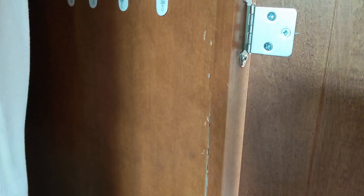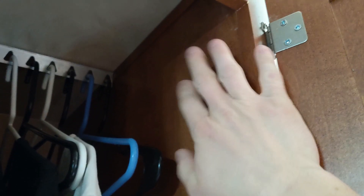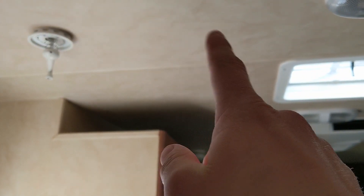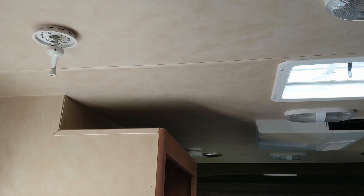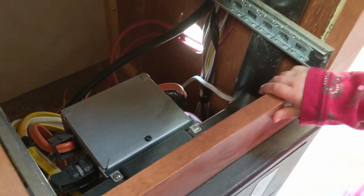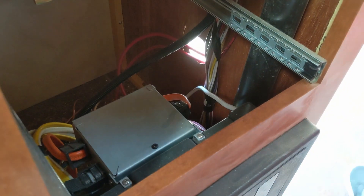To get my cables up through the roof, I've got this little closet here — I'm going to remove this panel and see what it'll take to get right through there between these two pieces of wood through the roof. My actual panel itself will probably be mounted somewhere above this area. With any kind of charge control or PV system, you want the shortest amount of cable possible so you get the least amount of voltage drop.